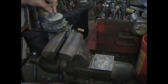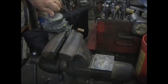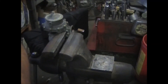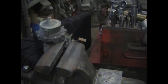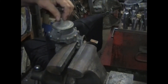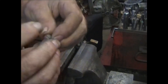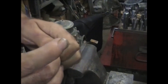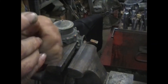You want to remove this top cover. This bolt will have a fiber washer underneath it. If you are going to do this at home and you order a kit, a new fiber washer will come with the kit.